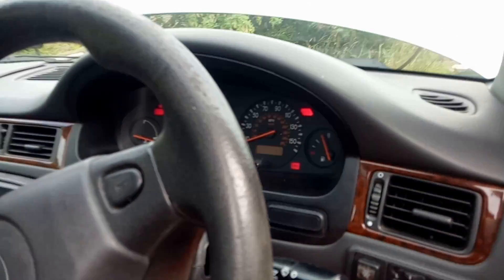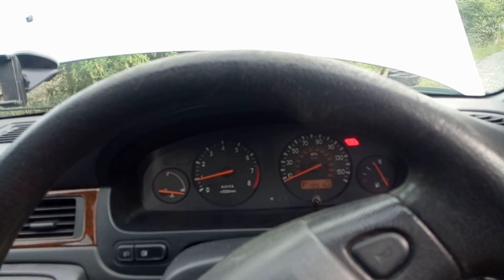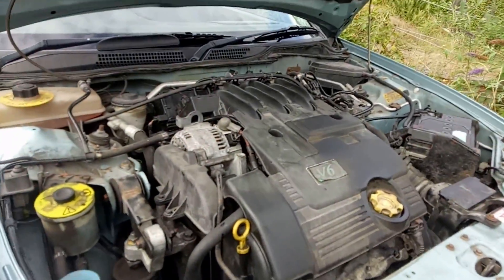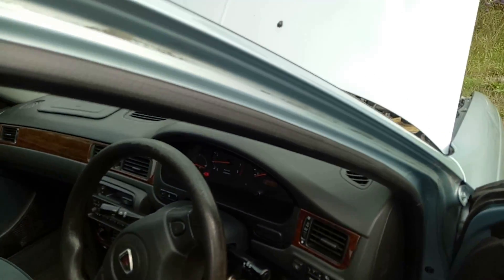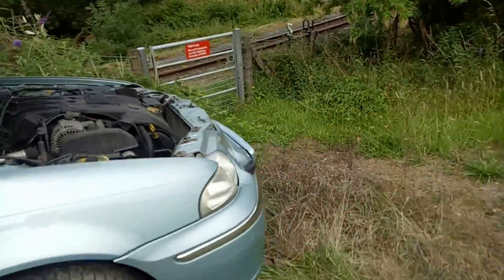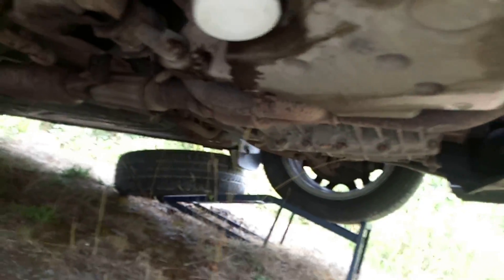Right, we'll just start her up then. The oil light just flickered briefly - I had filled the oil filter beforehand. Sounds all right. Let's get the oil circulating a bit. And we'll just do a leak check, and let the level settle again. I'll have to get her off the ramps, really. There's a bit of a dribble going on under there, but I don't think that's leaking out now. I think that's just residual.